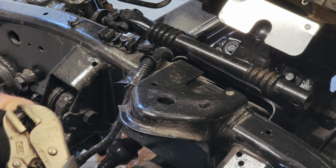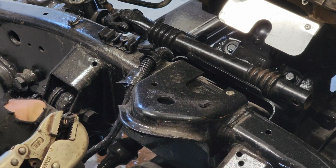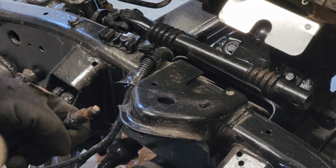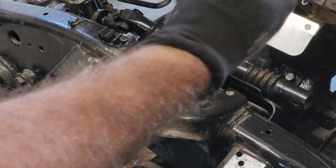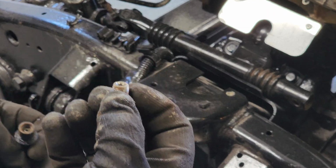would contact the customer to see if I could just buy the brake line, and I would tell them what's going on. Like, I would much rather buy a brake line than have to put heat on something to save it. Also, if you put heat on something, it could melt it, and then, oh, there you go anyway. But just like that, the fitting came out.